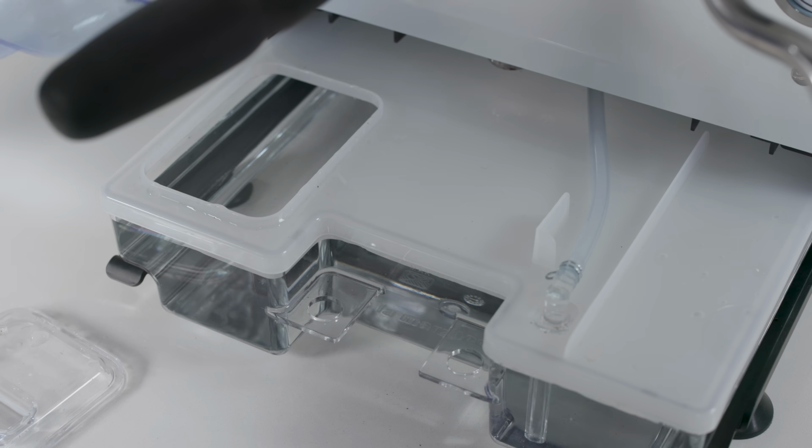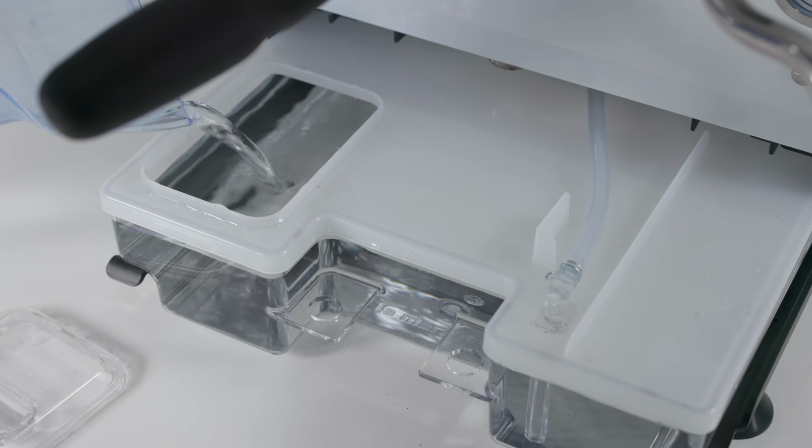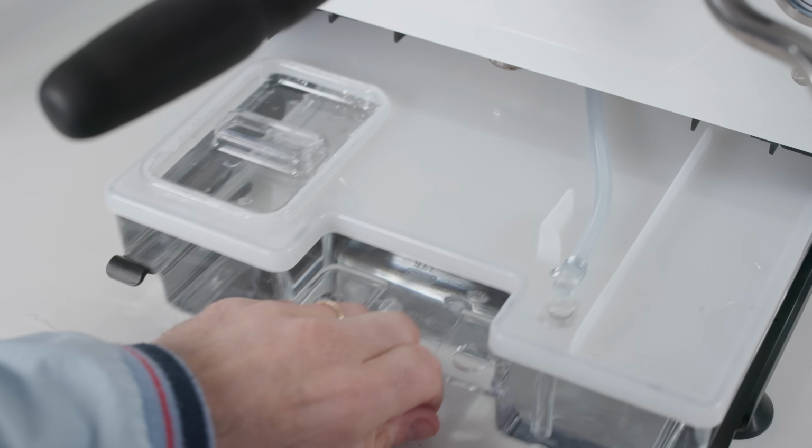Yes, it's plumbable. So when you plumb it in, you can do what's referred to as the pre-infusion as opposed to pre-brewing. It doesn't use the pump to put 9 bar into the puck. It uses line pressure to saturate. So you have 2 different options there. I kind of prefer that bigger hit. So I prefer the pre-brew style where it's like bing, bang, bong. But I know a lot of people like that gentle pre-infusion because it's so traditional. What are you gonna do? You know what I'm saying?